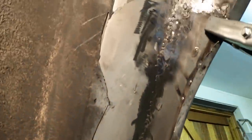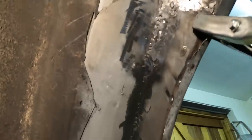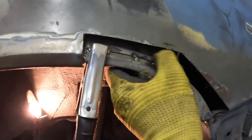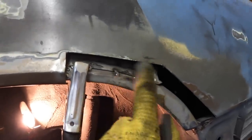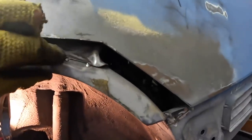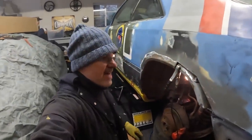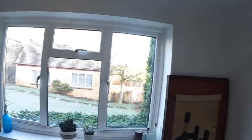I can't quite say I'm proud of it, but it's done the job and it's taken me so long. That top bit in particular I kept going through, so I had to use another small patch on it, but it is in. On this side, ordinarily it would have spot welds from the other side, but I forgot to clean underneath before I put this in, so I've just done a few spots here, which will do. This one I have to redo because it's gone through, but getting there — almost ready for the outer panel. It's taken so much longer than I thought. Well, this is day three now filming the Bismarck work.